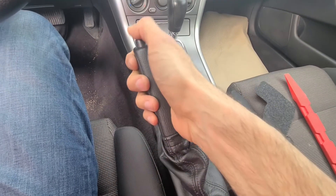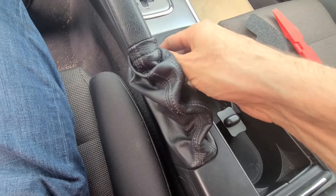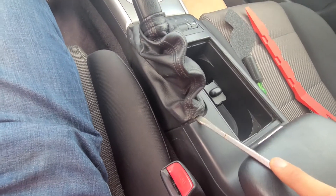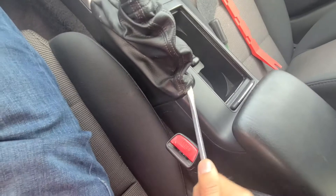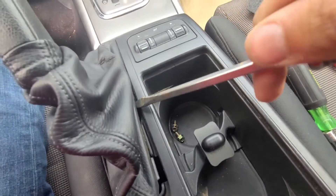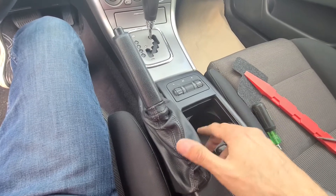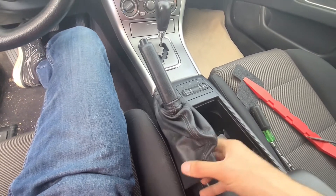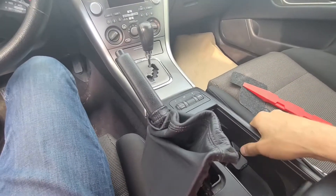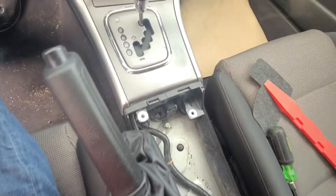You want to lift up the handbrake and also pop out the leather cloth piece that's surrounding the handbrake. You want to pry it here — in this case I'll use my flat screwdriver — and just remove it. You want to go all around and pop all this out. The idea is to pop this piece out; there are just a couple of clips holding it on the back side, and that way you'll be able to lift up this middle console.